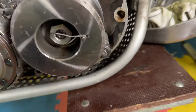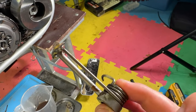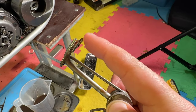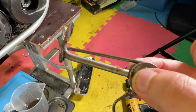No play at all in that — absolutely fine. But if we can get the camera underneath, the end of the chain tensioner has come apart — it's falling apart. Let's get that replaced. Look at the state of that chain tensioner — this jagged end here has been rubbing on the chain, going clunk clunk clunk along the chain. That probably explains it.